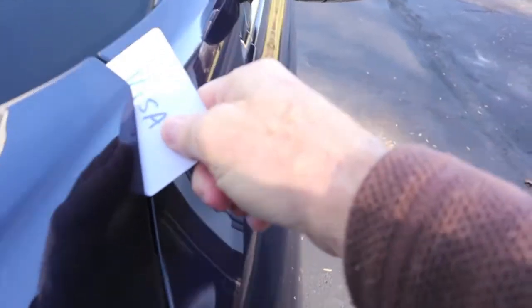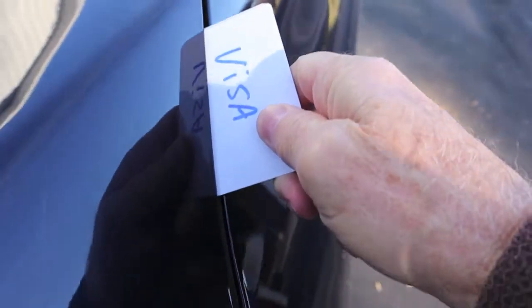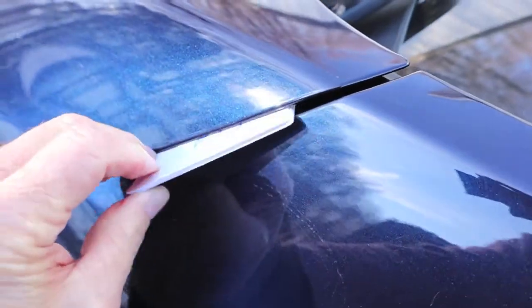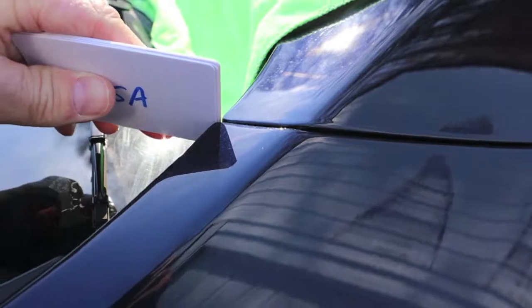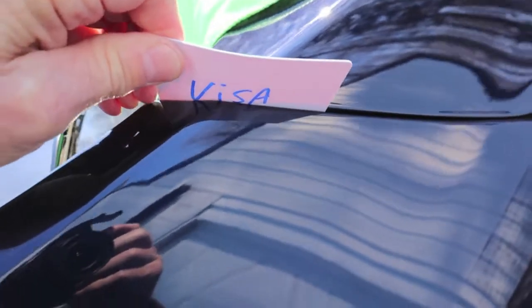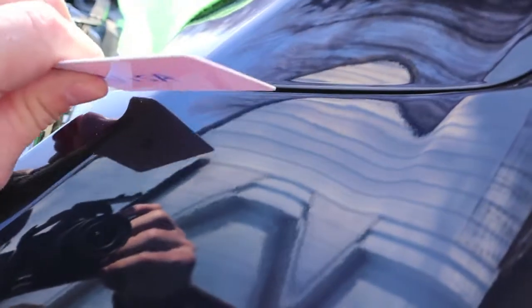Two cards with slop. Let's try three — three cards and we're going. Wow, figured I wouldn't go more than four cards. There's four cards — very sloppy right here. You can see the gap in it, it's huge. Let's go to the other side — not even close. You can just take a visual and see how tight it is. Of course, we know it's tight. One's all we're going to get in here right on the bend. It's really tight.